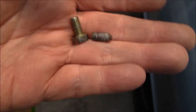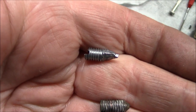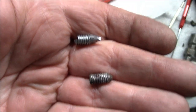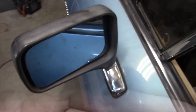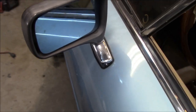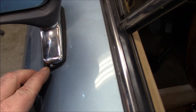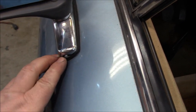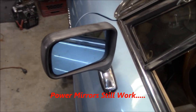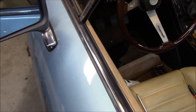Let me do the modifications to this bolt and we'll come back and see if that works. Here's what we made - hopefully that's going to work. That worked perfectly actually, nice and tight now, no wobble up and down, no wobble back and forth. Much better than that old Robertson screw that was sticking out of there. This little rubber tab could cover this a little bit more and probably needs to be stretched a little bit. We'll just confirm that the power windows still work and then put the door panels back on the driver's side.